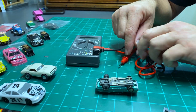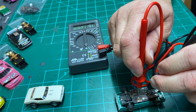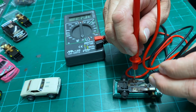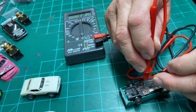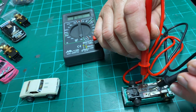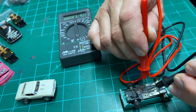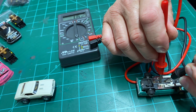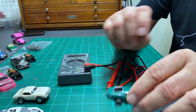Can you test one in the car? The answer is yes. Try to test on the brush — try to bypass the brush spring. You'll get a little bit of bouncing, but it looks like a 12.2. Rotate and we get 12.1. Testing through the brush seems to read a little higher than testing the armature straight. There's a 16 — 16.2. So I'm going to think this is probably a 16 armature. It's an old Johnny Lightning chassis, so that's probably pretty accurate.